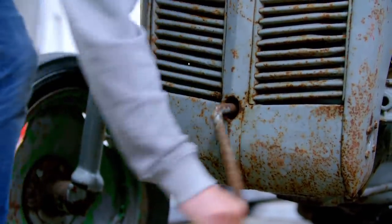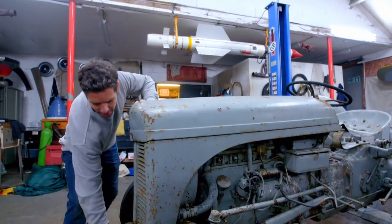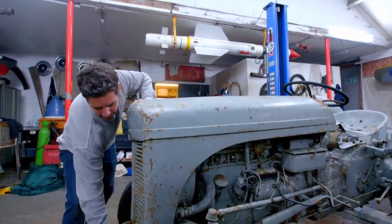You should be able to feel the compression on all four of the cylinders, and it just doesn't feel like that at the moment — it's turning over too easily. For the engine to work, the fuel and air mixture needs to be compressed inside the cylinder. No compression means that air is escaping somehow, and I need to start taking the engine apart to find out why.